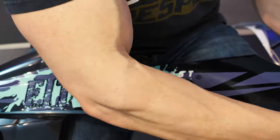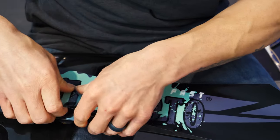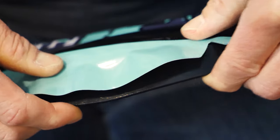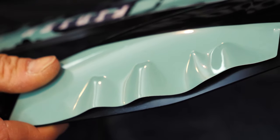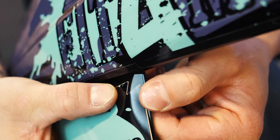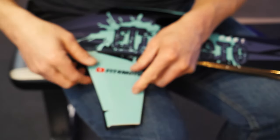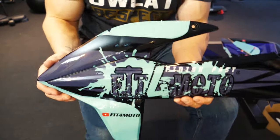It's important to start from the middle and work your way out so that you minimize any air bubbles along the way. What you're gonna find though is that you do run into some little ripples. That's not a big deal — you should be able to use a little bit of elbow grease, use some thumb strength and just push those ripples down. You can also use something like a credit card or a piece of plastic and use a little more force to evenly and smoothly apply and get those ripples out of there. Again, use a reference point like the little notch cut in the graphics, visually align that before you try and stick it first to see how it should look when it's done. Then use a measuring point and check your work when you're done. If all goes well, you should have one radiator shroud all done.